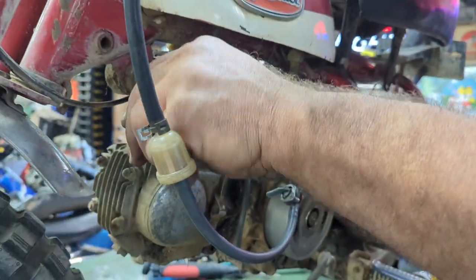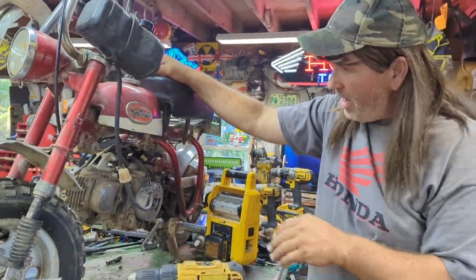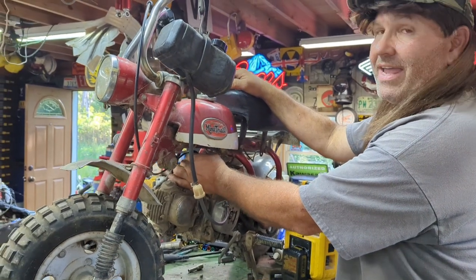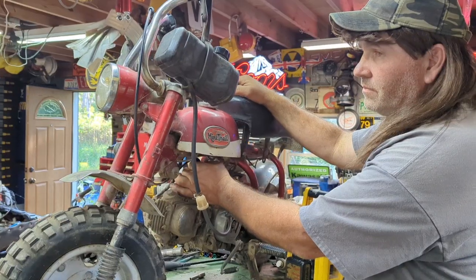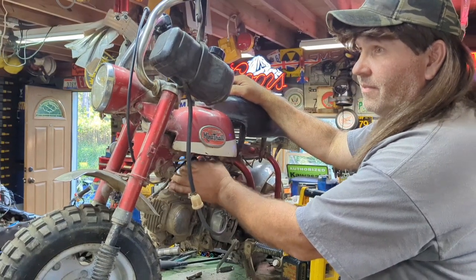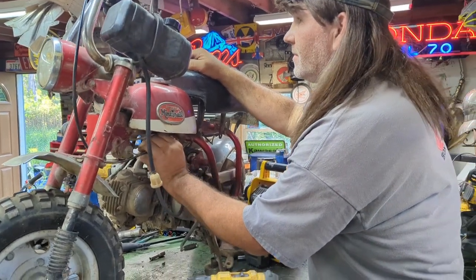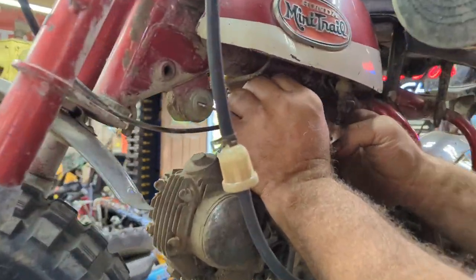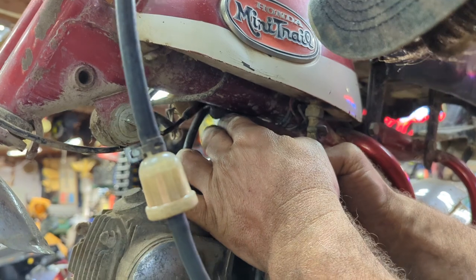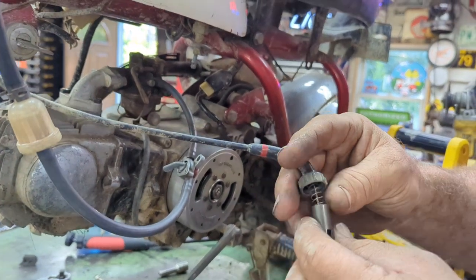All right, guys, really running rich, and my guess, if I can guess, is that the slide needle is up too high. I'm going to show you that. So you pull your slide out, here she'll come out. This thing right here, I think, is up too high.